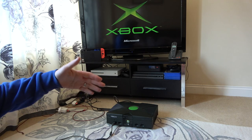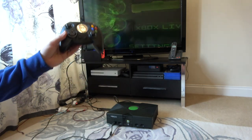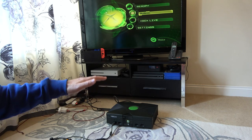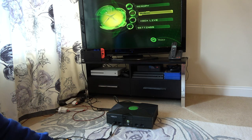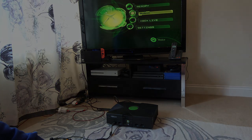To make it perfect, it would be good to also change the clock capacitor and the thermal paste on the CPU and GPU. As far as the clock capacitor is concerned, all you have to do is press A to get past that screen, so it's no real hardship. All in all, a nice easy fix once I found out what the problem was. A flashing red and green light won't always be the output capacitors, but it's something to bear in mind — apply a little heat with a hairdryer or heat gun to see if it comes to life. If it does, that gives you a clue the capacitors have failed. There we have it — one fixed Xbox that will hopefully last many years to come. If you enjoyed this video, give it a thumbs up and stick around for more. Thanks so much for watching!